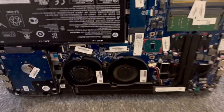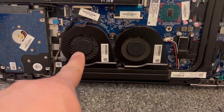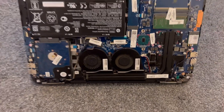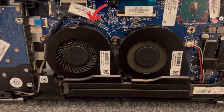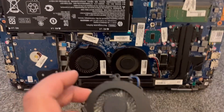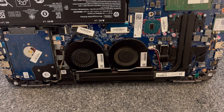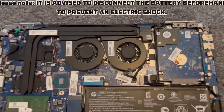So once the laptop's powered on, it should normally spin at the initial stage, which it's not. So this one is working. The other one is not working. The bearing is gone on the faulty one — it's stiff to turn around. So the motherboard has picked up the error message. This is the replacement fan, so what we need to do is replace this fan.